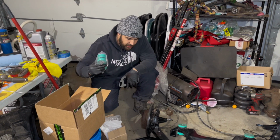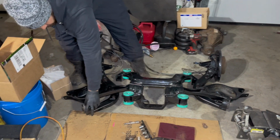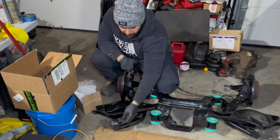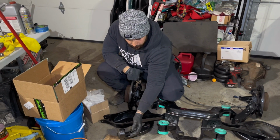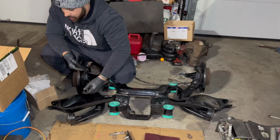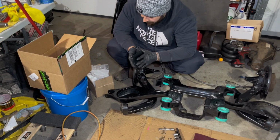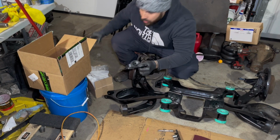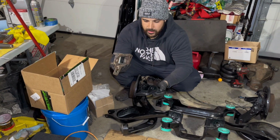We actually need to change out the front diff bushing over here. The trailing arm bushings, these, remember in the other video, they were pretty shot. These need to be replaced on both sides. One thing I would recommend when you're changing these, you have the stock bracket, and this is the stock OEM bracket, right? And ours is just rusted, so we needed to change it anyway.